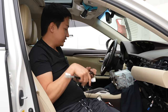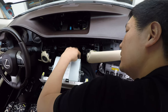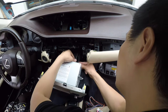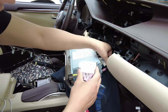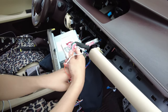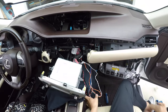We're going to make both connections behind the radio right now. We'll connect the big main connector and also our auxiliary harness. The big connector is over here — push down and use something with a flat long edge to push down the release tab, releasing the connector, then remove it. We are going to daisy chain our connector: the female side connects to the male side of the car, and then the male side of ours connects to the radio. Everything will snap in place nicely.